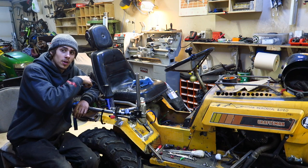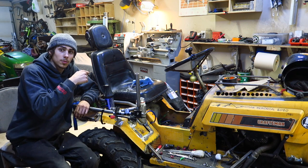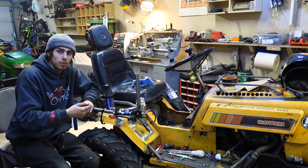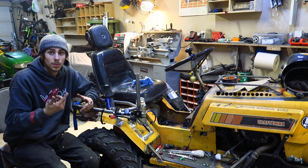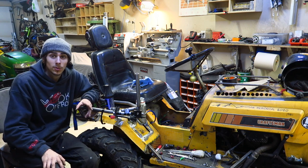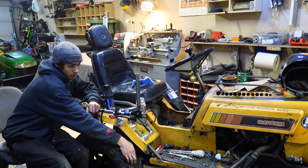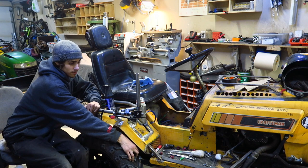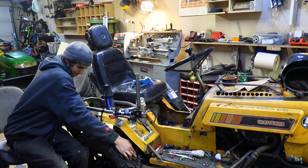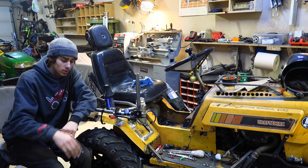I'd go down to the caliper itself, little 8 mil, crack the bleeder valve, boom, a little bit of juice comes out, crack it back, come back over here, pump, pump, pump, pump, pump, repeat the system many times over until it's shooting clear, no more air bubbles in the line, and you'll end up with a very strong system. And you'll see out on the trail tomorrow that I won't be able to move this tire. It is locked in there. The hydro brakes just work so good.